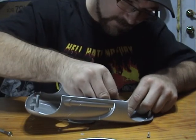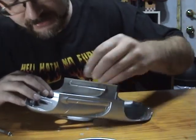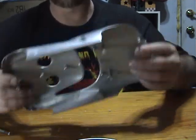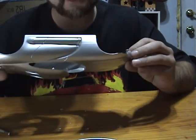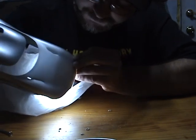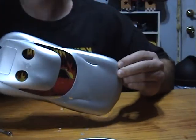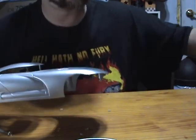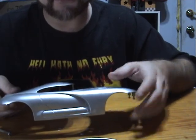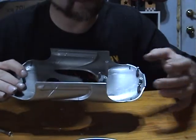Let's go ahead and get this back together where it belongs — or if you're more prepared than I am, you just bag and tag the screws correctly. Because like I said, the paint is very thin. You can see the mold points here — that was pretty obvious if I were to have put headlights in without repainting it. What I ended up doing on this particular Defender was after I got done doing all the body work and getting it sanded down, before the regular primer, I went ahead and sprayed it flat black on the inside, so that way none of the extra light would come through when I set up the LEDs.